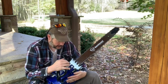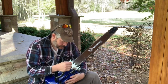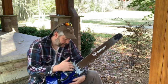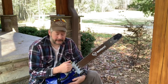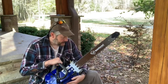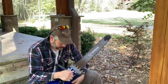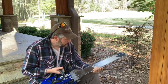The only thing I'll show you: I actually put this saw dog on this side on wrong. And so I had to flip the little bolts the opposite direction so it would fit those little guards in there so they wouldn't be pushed out too far, and they were pinching the chain, so that was the problem. The little plastic guides in there were pinching the chain so it wouldn't roll. So anyway, that was really the extent of my only difficulties putting that thing back together. And then I'm excited about getting some fuel and oil in it and trying it out.